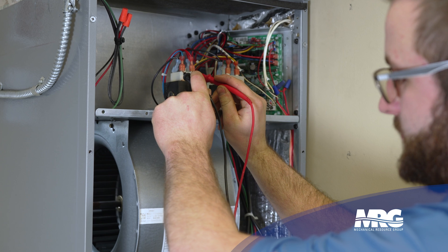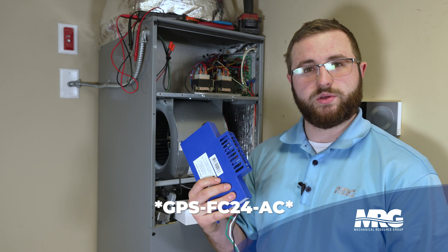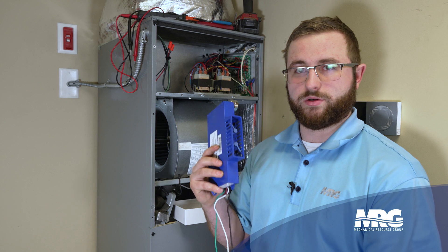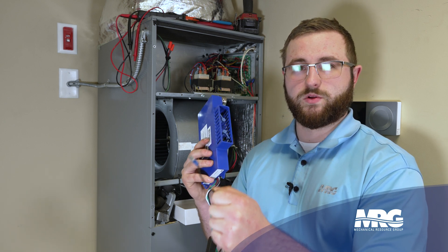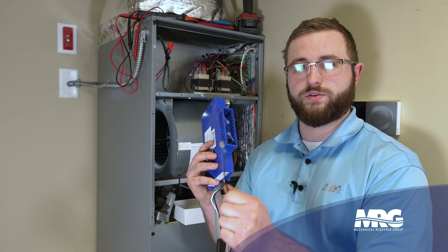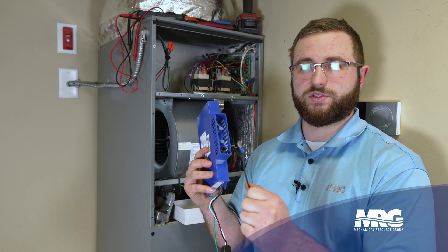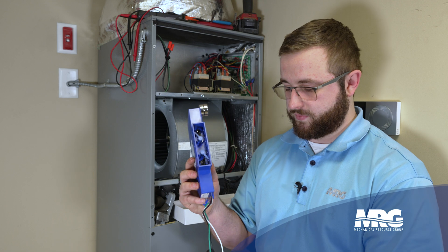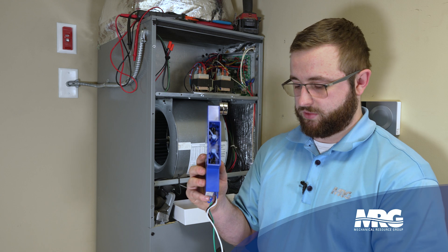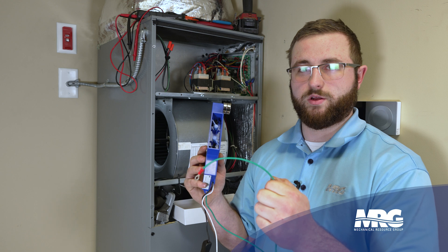We're going to be installing our FC-48 GPS unit. On the unit we have our windshield wiper brushes. For wires: we have a black wire — this is our multi-tap hot wire, handling 24V, 120V, or 240V. On this model you do not have to select voltage; it detects it automatically. We have a white wire for common and a green wire for ground — you always want to hook up your ground on a GPS unit.